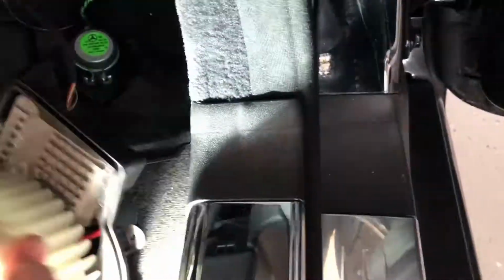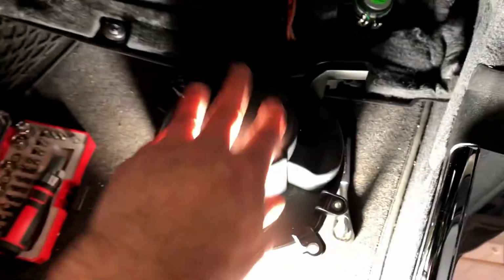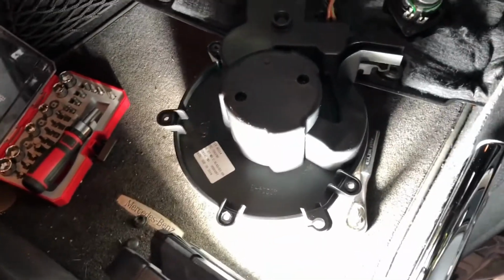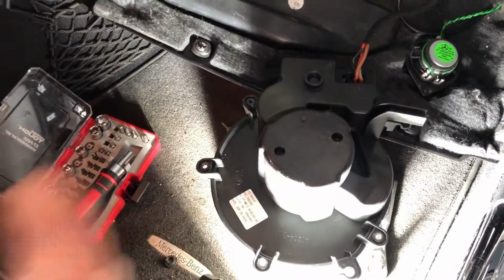So we've got this over, and there is the plug. Well, the clip, the plug comes out. What we need to do is, I believe these little caps here, 1 and 2, reveal two Phillips head screws. That will take this cover off, and then give you access to the control module, which we need to install on the new unit. Great.